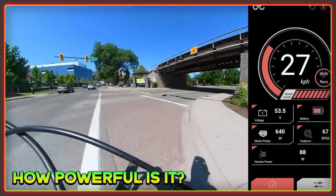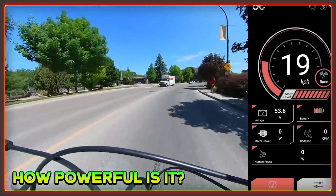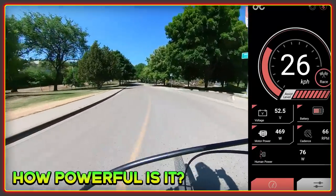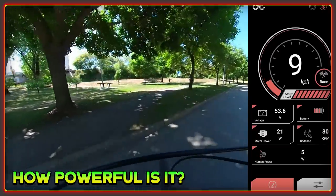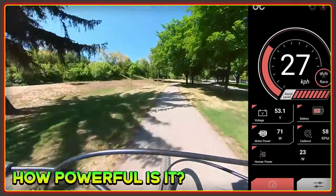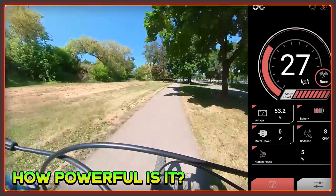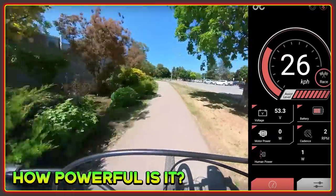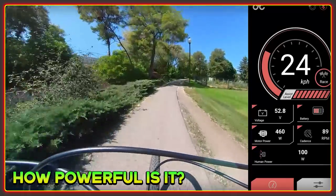How powerful is it actually? If I was to level a criticism at the e-bike industry in general it's that they tend to exaggerate power numbers as well as things like battery range. CYC are no exception, tending to claim things like 6kW for the X1 and 2kW for this one. Yes you can extract those figures but not for very long. In the case of the X1 it tends to result in mechanical issues much more quickly. I would rather more conservative numbers were provided. Perhaps companies are scared that if they choose to be genuine and honest with figures this stuff won't sell. It is though a genuine 750W motor — you can run sustained periods at this level of power. You can still get it hot doing this though depending on external temperatures. In cool weather at the start of the year I was able to push it beyond this for decent periods of time. It's not a big motor, don't expect miracles — but it does feel really great to ride.